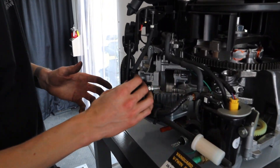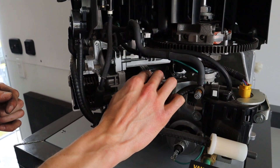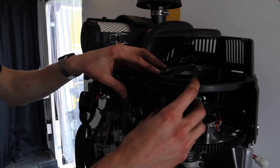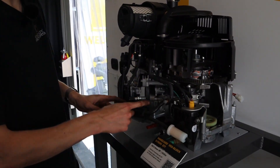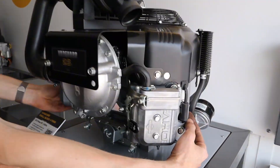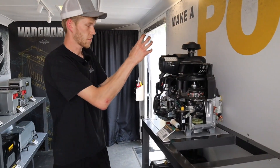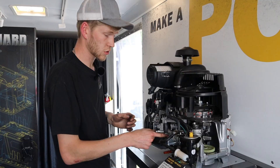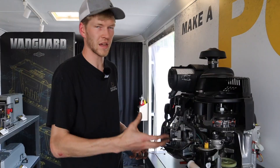So your oil is going to do most of your lubricating - it's getting pumped to the head up here to lubricate your valves, and it's also seeping past these rings just a little bit to lubricate the rings as needed. A very important piece of all motor engines is this fan sucking air through this top piece here and blowing it across these fins. On some of these other engines you'll see aluminum shrouds on the sides covering those cylinders - those are there specifically to keep that air flowing past the engine. Without that, your engine would overheat pretty bad. The fins dissipate heat so that when air gets sucked through from the top and blows across them, that's what cools them down.